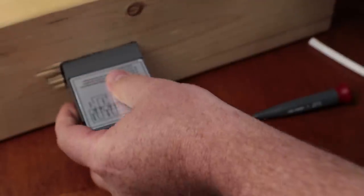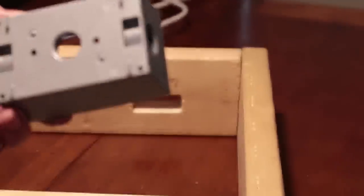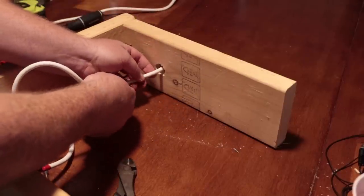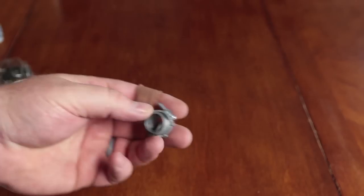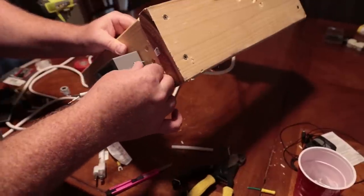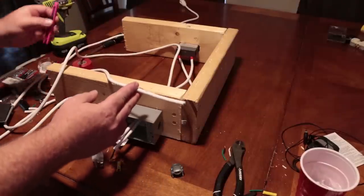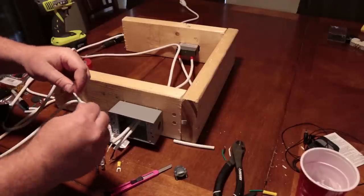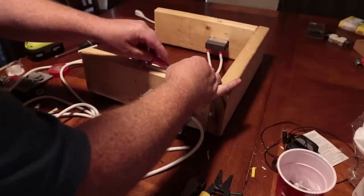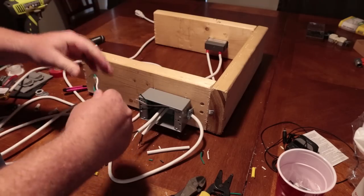Once you're done, slide the ITC unit back in the front of the keezer. The metal plug box on the back doesn't have mounting holes, so drill a couple of holes on either side and screw it into your collar. Run your two wires through the hole in the center, install the cord retainer, and strip a good length of wire off the power cord so you have room to work. Also cut a couple of extra short pieces of wire and peel the insulation off — you'll need an extra neutral and an extra ground wire to make all connections properly.